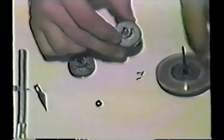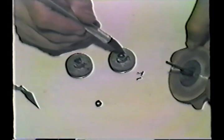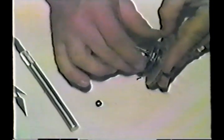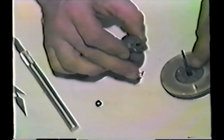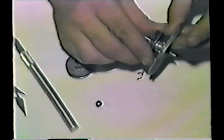And what happens is these bearings will wear out. They'll either wear these grooves a little bigger, or they'll wear down the edge of this metal where they attach. Now the way this operates, these little needle bearings, when they're off to the deep side of this groove, are loose, and they'll let it spin when you turn it one way. But when you start to turn it the other way, they go to the shallow side of this groove and wedge between this metal and the metal of your pulley to hold it in place.